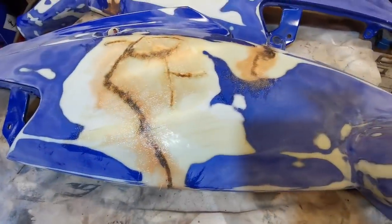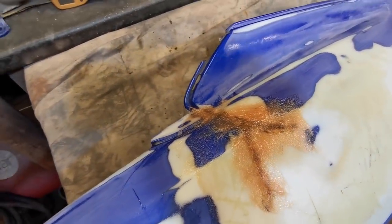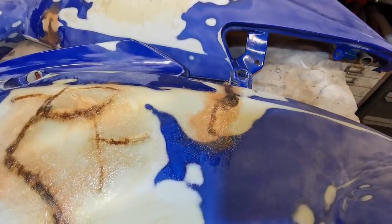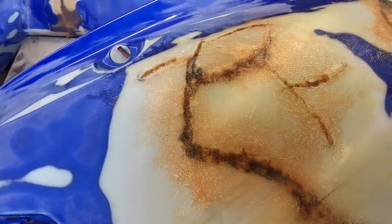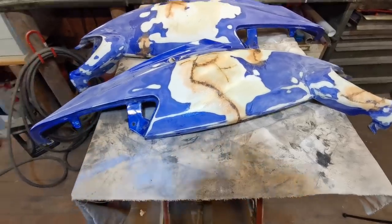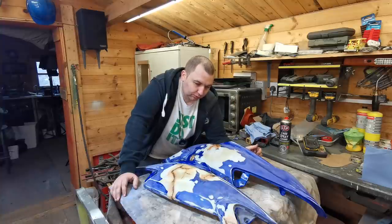As you can see that's all had a coat of the fiberglass filler. It has been plastic welded and I've just gone over it with the fiberglass filler just to give it that extra precaution - it was solid before we added this filler. This filler was just going to blend in all them little gaps left from the plastic welding. We're going to leave this to set - I'll come back tomorrow to give it a good time to set, then it'll be ready for the rub down, hopefully get these in some sort of primer and then get the front panel done.